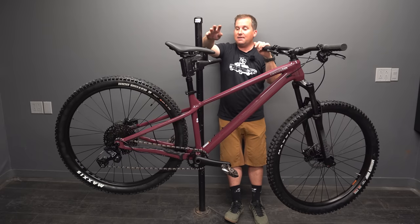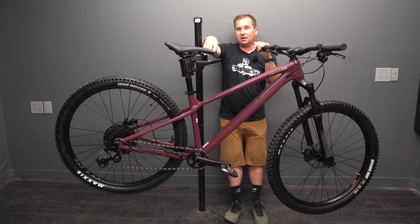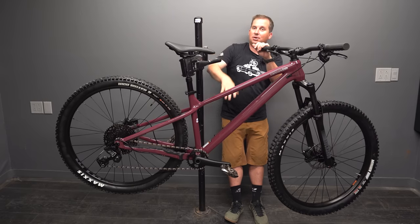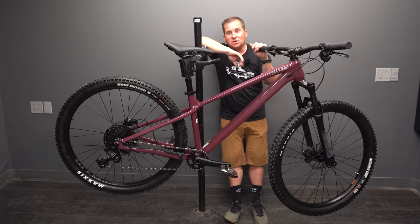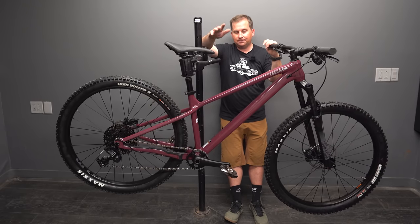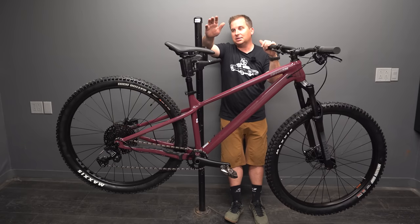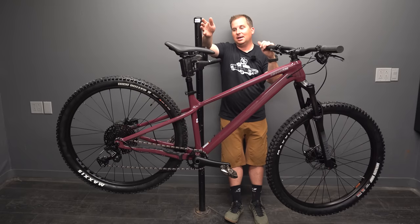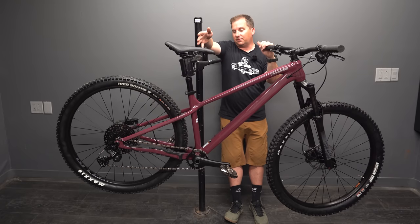Great. I find, especially when goofing around and trying to make it feel more like a pump track bike, getting that dropper all the way, getting that saddle all the way out of the way makes a huge difference for bunny hops, jumps, and just moving around on the bike. So that's not a deal breaker, but it's sad because a lot of people are still going to buy a dropper to upgrade it. And at that point, why pay for the dropper in the first place?